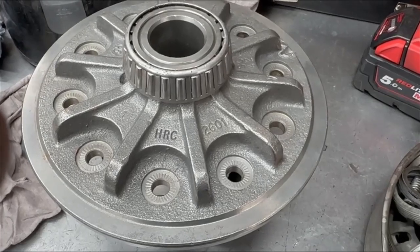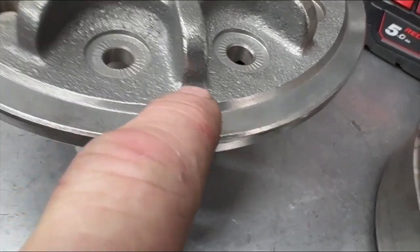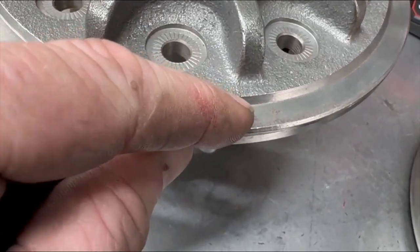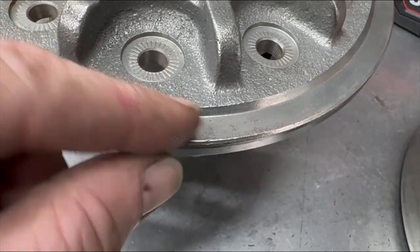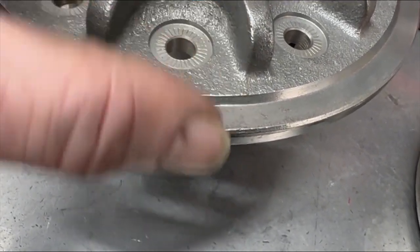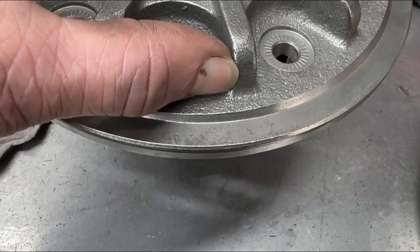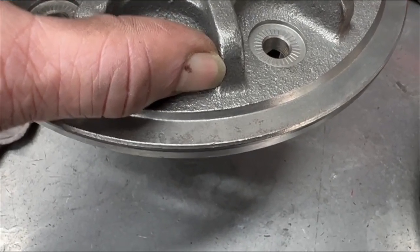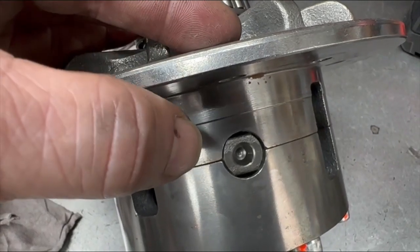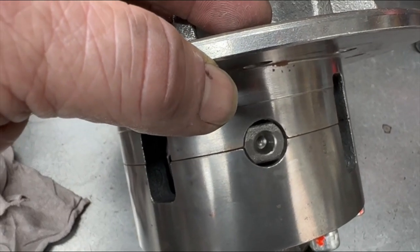To peg a short nose, we have to do a bit of machining. This flat here — what we do is take it and machine it right back to the edge of where the webbing starts, and the reason we do that is twofold. One is it gives us room in our peg case to put the pad in. But also we've seen them where they've been modified for pegging where from my thumbnail to the front is completely machined away. The reason they do that is it's really quick — you just put it in the lathe, put it on power feed and take off about 20mm of metal. The problem is this actually makes a huge difference to the thin crown wheel that goes on the back.